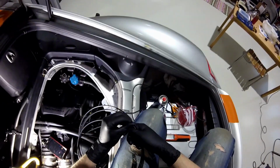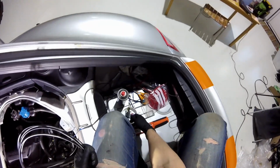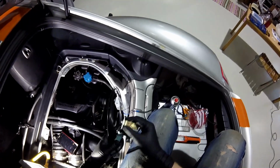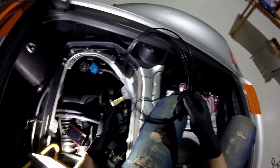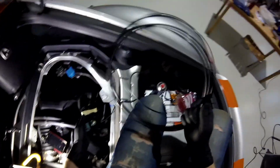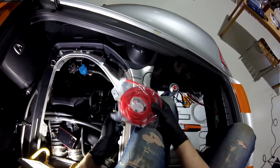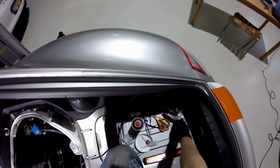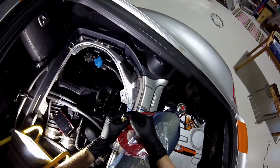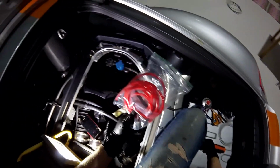Okay, time to install the vacuum hoses. Included with the kit there is this hard plastic tubing that you're supposed to use together with the rubber connectors here, and this is gonna go brittle in the heat in the engine bay and crack, and then the functionality is gonna be disturbed. So I'm getting rid of this, and instead I bought silicone hoses. So this is a 4 mil diameter inside here. I used this on my turbo engine on my Saab, and I know this stuff works.